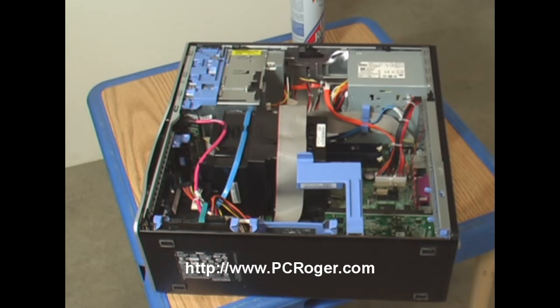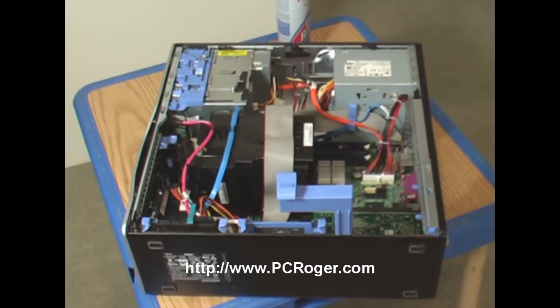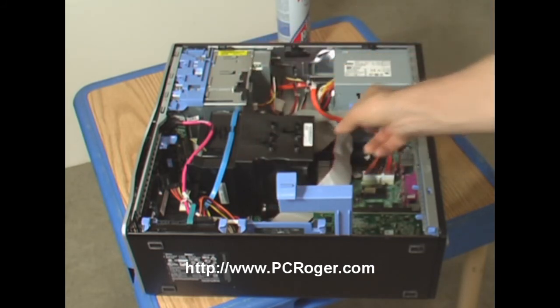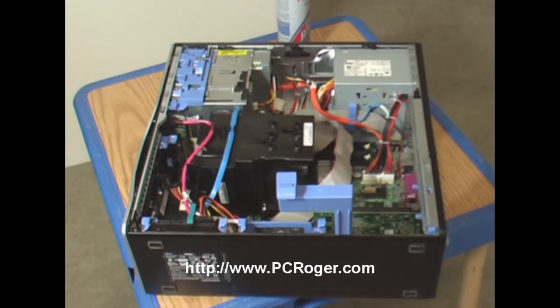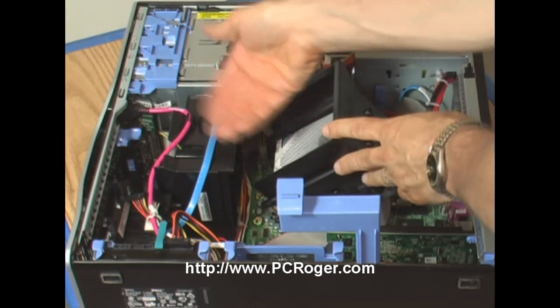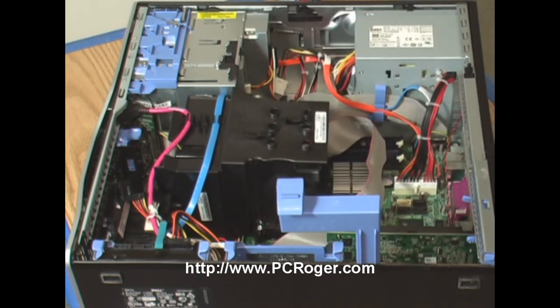Here's the inside of that T-3400. This machine also has a fanless design on the video card, which is under here — it's just a black heat sink with no fan, but you're going to make sure those fins are clear. It has a shroud, and this would only be for kind of deep cleaning. There's a screw down here and down here, and you have to get the floppy drive cable out of the way if your machine has one. This shroud tips back and you can completely get into the fan underneath here, or the cooling fins for the processor. Since these machines do not have a cooling fan directly on the heat sink fins, it is very critical that you get the air moving through at the desired rate of flow in order to keep the machine cool and prevent reboots and blue screens of death.